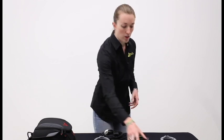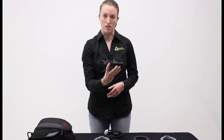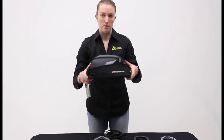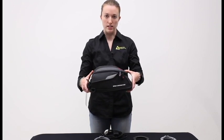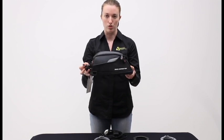The second type of tank ring is the EVO tank ring. The EVO tank ring is black. When you mount it onto the bag, you mount it just like the original tank ring and find the correct positioning on the bag. When you mount the bag onto the motorcycle, all you do is line up the tank rings and press down. When you want to remove the bag, you pull the cord at the front and lift it straight up.